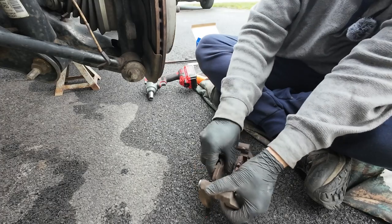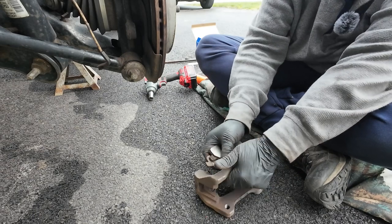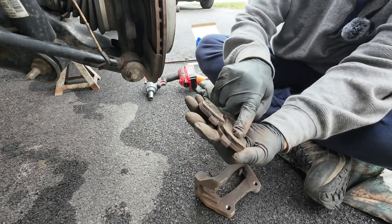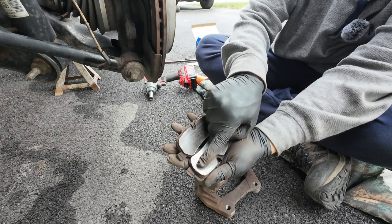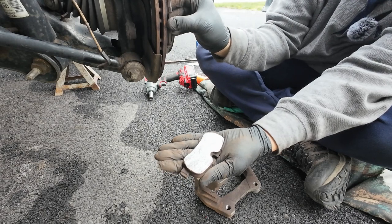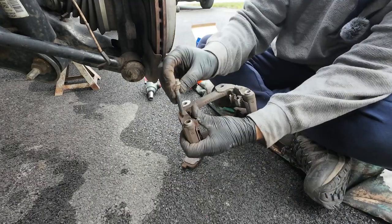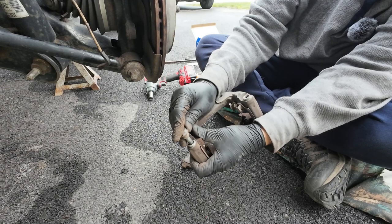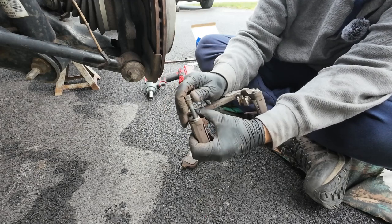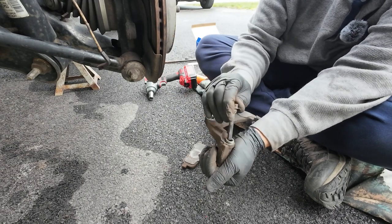Then you pull the brake pads off. With those jammed up like that, these were never going to work. See how they've got little rust particles in them? See how it's rusted going across? These weren't used — these were not making contact. It's because these pins were too stiff. Once they went in like that, they sat there. These are supposed to go back and forth like that.